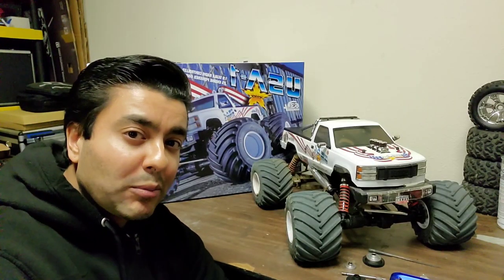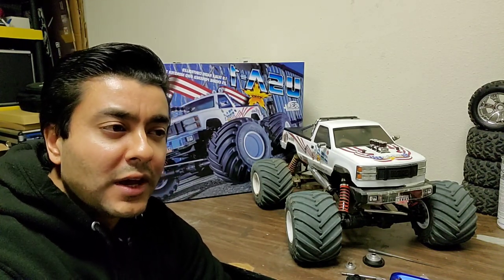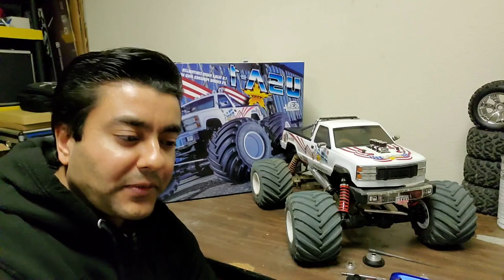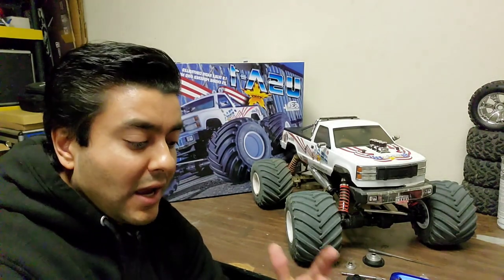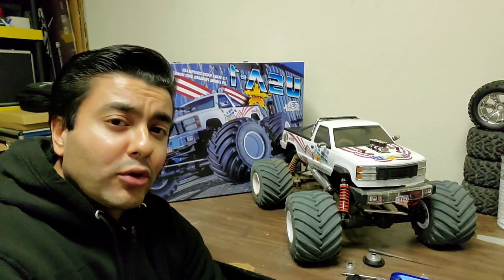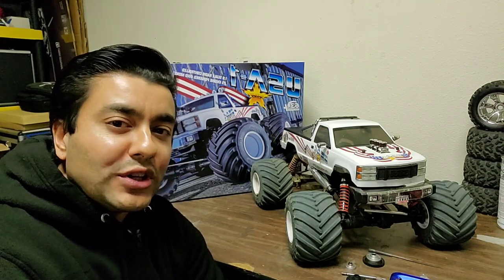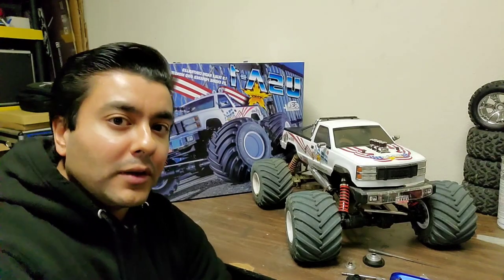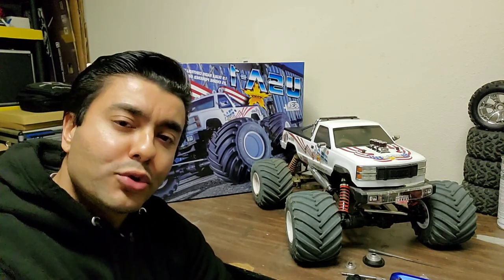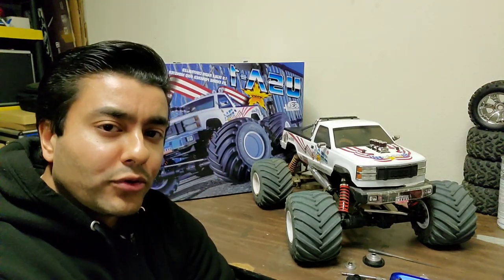As you can see it was working really beautifully there. I was testing it out on the curb because when testing off-road the engine bouncing around makes it kind of hard to notice the shifts. Putting it on the curb lets you distinctly hear each shift. It was working great for about 15 minutes, then I went to refuel and suddenly it wasn't shifting into third again. No matter what I did with the adjustments it just wouldn't shift into third. I took it back home, disassembled the transmission again, and found that my third gear — the new one I just installed — was also stripped, after just 15 minutes of use.